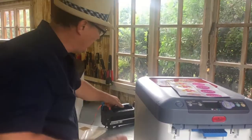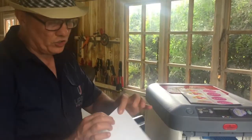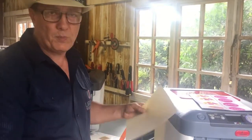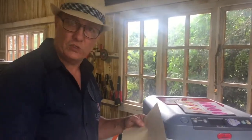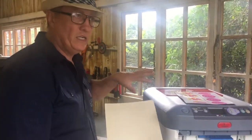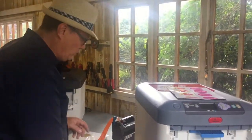We do not put this through a heat element, because if you put this through a heat element the lamination on this would delaminate. It's also very thin and it would fuse on the page, which is pointless. So for the guys who always say 'can't we just use your yellow paper, we're very interested in your yellow paper but we've got the Oki' — this is the reason we can't sell that to you.